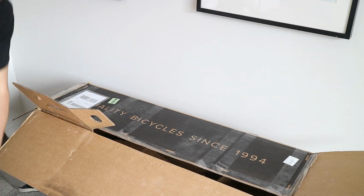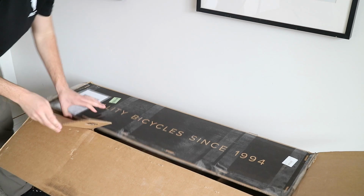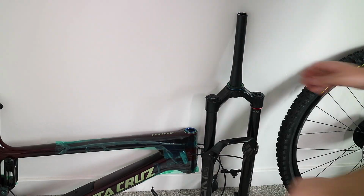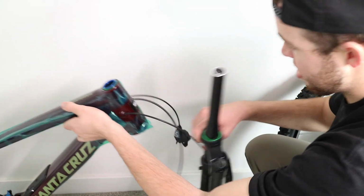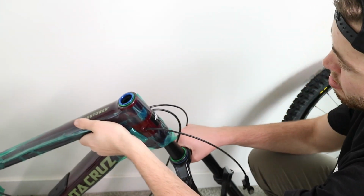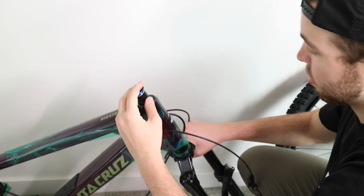One thing I don't show in this video is make sure you grease the front headset. This needs grease in the frame quite a bit. Not an excess amount, but make sure those bearings are heavily greased. That way you don't have any issues with failures prematurely.